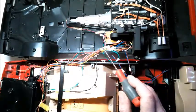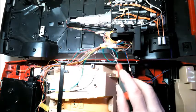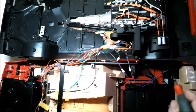This is how all the wires should look when all the connections are made. You can put some masking tape over the main bundle to keep it into position, and make sure you route the rear light wires behind the boot liner.